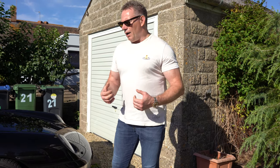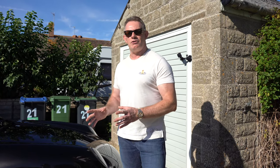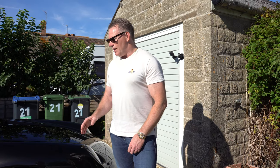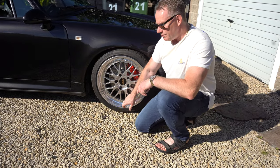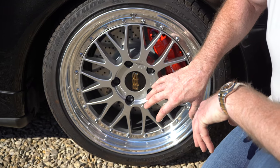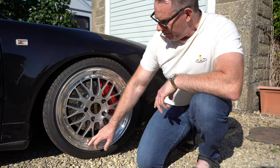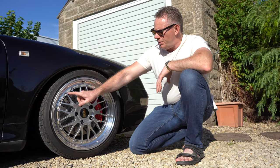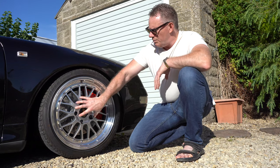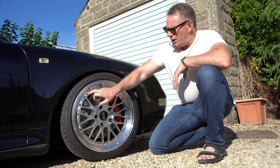BBS procures the parts separately and fits the wheels together. Once the wheels arrive they're all QA'd, the nuts are all torqued up, and they're ready to be fitted to the car. But to get this reversed fitment style, you then have to dismantle the wheel — you have to undo all the bolts around the wheel. In standard fitment the two pieces encompass the centre section and the outer rim. When the wheels arrive from RimStyle the centre piece is bolted on the outside; to reverse-mount them you undo all those bolts and remove the centre from the front of the rim.